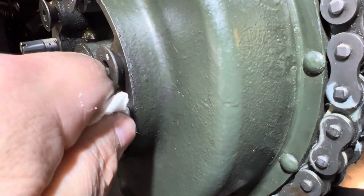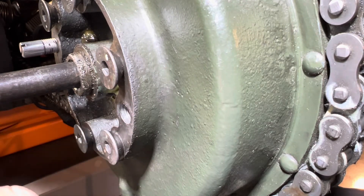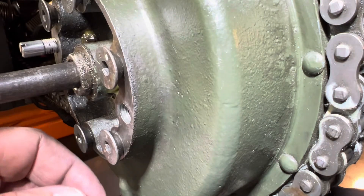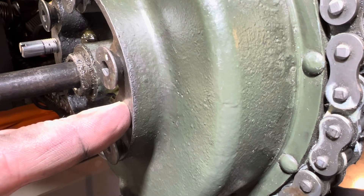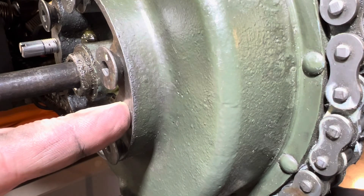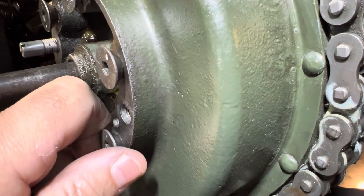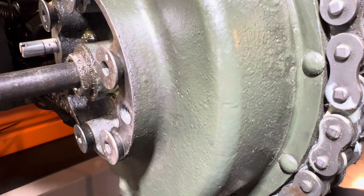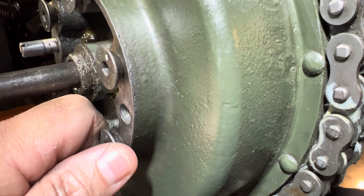Chase the threads if you can. If you have to tap them, use brake cleaner to clean out the hole — spray it in there. I actually feel better doing it horizontally than laying it on the workbench and doing it vertically, but that's just me. It works great and I hope you enjoyed the video. Hope it gives you some confidence to do something like this. I'm no expert, but if I can do it, anybody can. Appreciate the likes, comments, and subscribes — take care, bye bye.